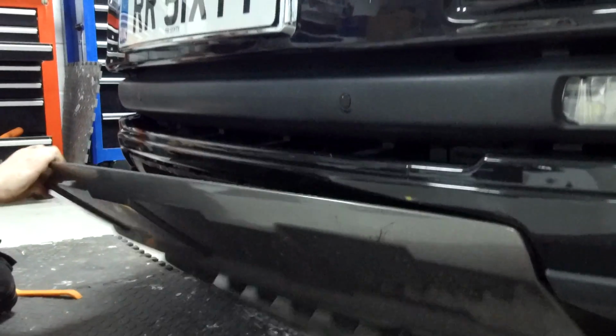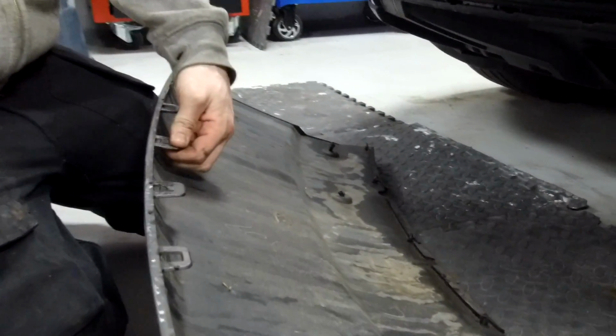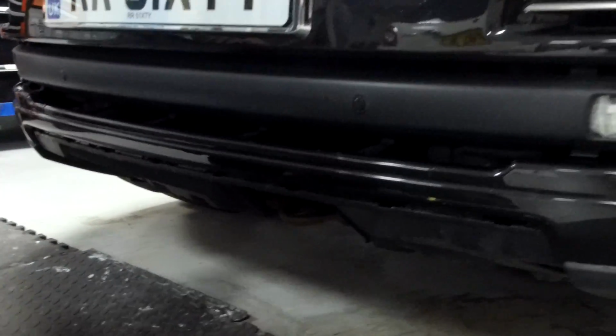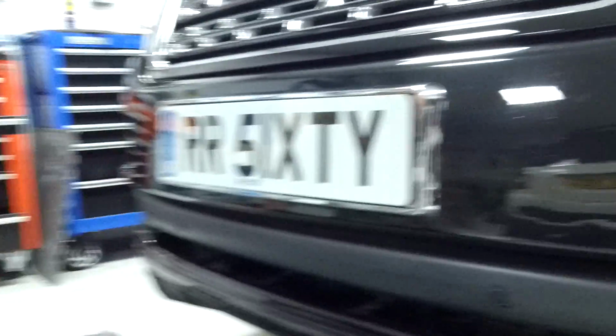Hold on. Once you overpower those corner clips, you're away to go. They are fierce clips. There you go. Top tip, keep a trim tool in your car just in case you break down. Right then, that obviously is called a tow eye cover because it reveals your big tow eye here, which they strap your car down with when you need recovery. Okay, so that's the tow eye cover.